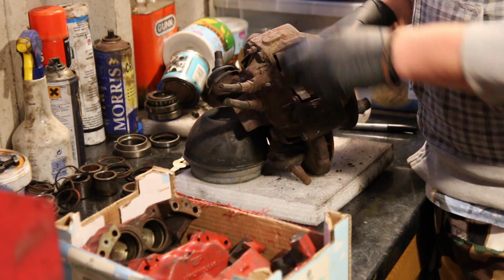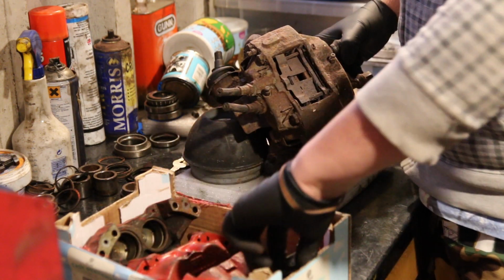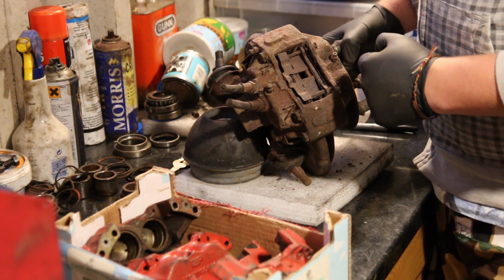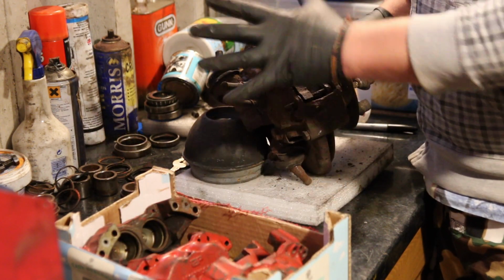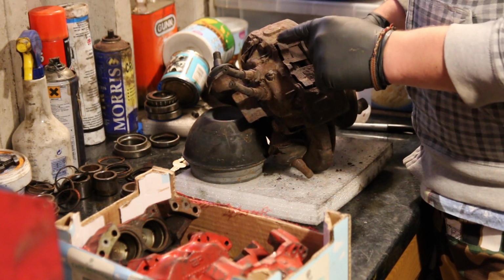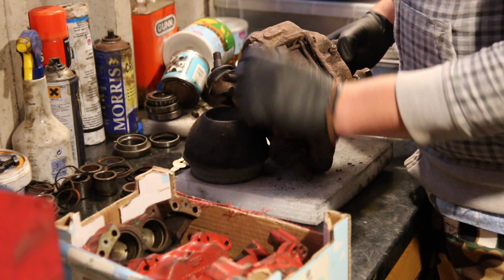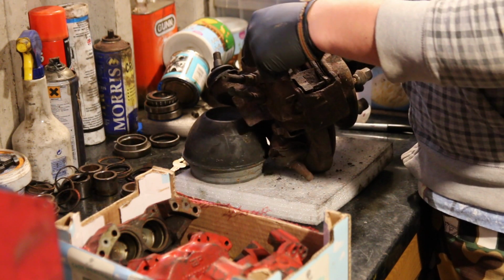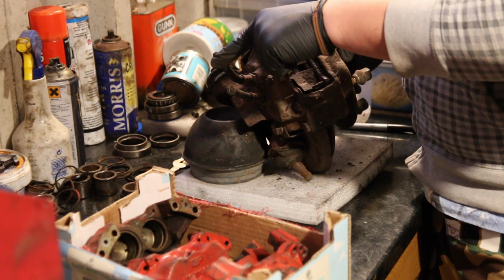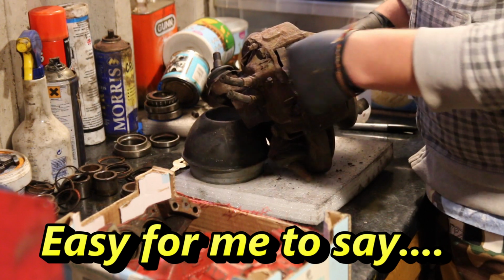Now these have obviously been split, so the 4 bolts, the 2 at the top, 2 at the bottom, have been removed to make this a separate part, and this a separate part, and all the other piping's been taken away. So if I happen to be rebuilding these, I'll have this as a reference to see exactly what goes where and how it happens. I believe when this gets fitted to a Mini, because it hasn't got the 2 feed lines, there's a loop of a pipe and then a banjo that goes through to join the intake pipe of the feed for the brake fluid into one bank of cylinders, and obviously the loop goes across to the second bank of cylinders.